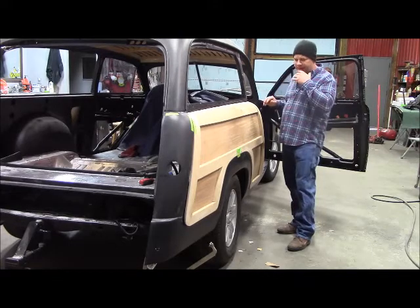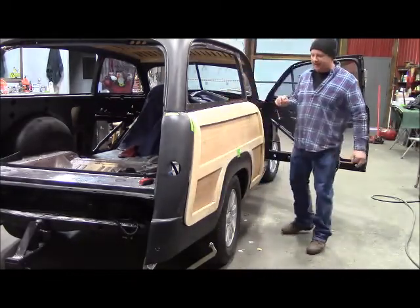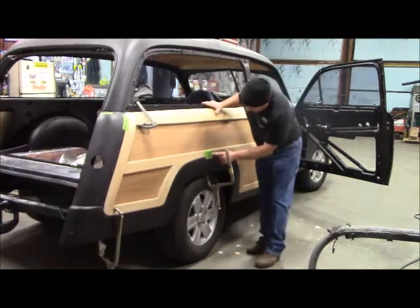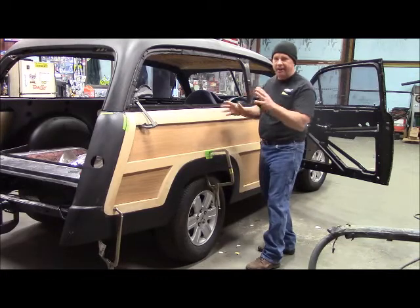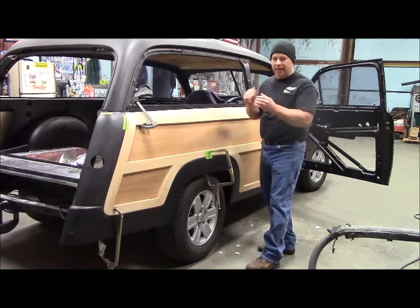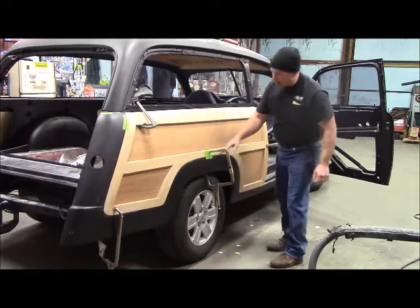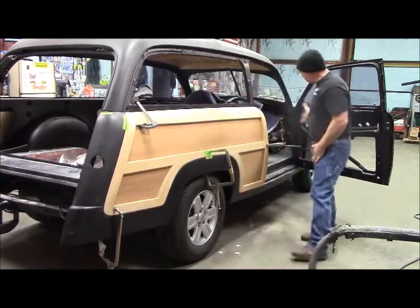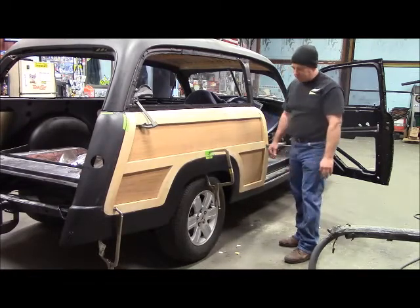I'll trim any wood out of the way that I can, though there's not much trimming you can do back here. It just doesn't want to fit — it's been a frustrating road. I've had this off and on quite a few times and I've indexed it after getting it positioned. Every time you trim a little here, it fits a little different there. I'm making small adjustments because I can't add the wood back. This body line all the way around the car is going to be one of the only spots where you'll see the body seam, so it really needs to be focused in around there. This is the worst fitting one, so it's going to be the toughest of all.